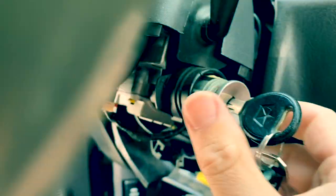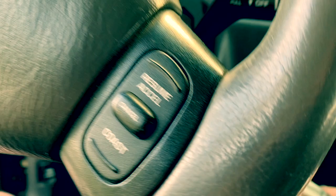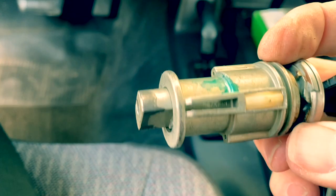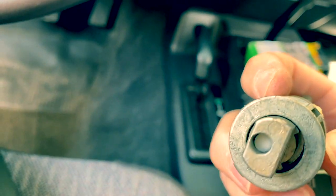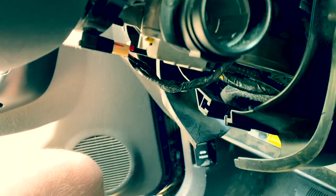Of course it's stuck — let's see what's going on here. There it goes. So that is your ignition key cylinder. You can see that pin — it sits just down in that hole. What I'm going to do is clean that up just a little bit, make sure we don't have any gunk in there, and then go ahead and do the installation of the new one.